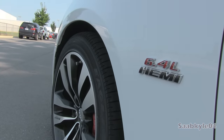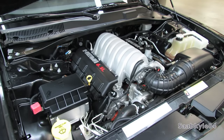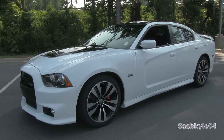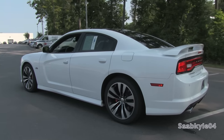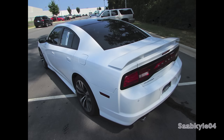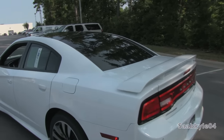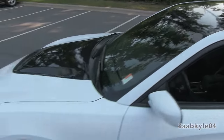The highlight of the second-generation SRT is the new 392-cubic-inch 6.4-liter Hemi V8 that first debuted in the 2011 Challenger SRT. Compared to the outgoing 6.1-liter V8, the new 392 benefits from increased horsepower and torque by 45 hp and 50 lb-ft respectively, with peak torque now available at 200 fewer RPM. Enhancements included a cylinder deactivation feature improving fuel economy by up to 15% in the city and 25% on the highway. Larger intake and exhaust ports were used with a new composite intake. Variable valve timing allows the cams to operate independently, varying with throttle loads for power or economy. The active valve exhaust system allows the car to run under four-cylinder power through a greater range of engine speeds.